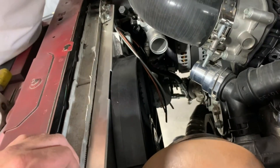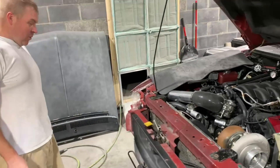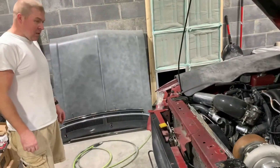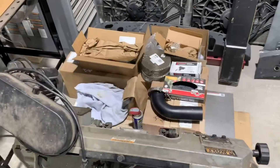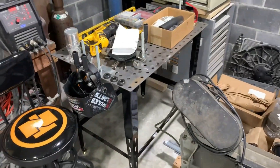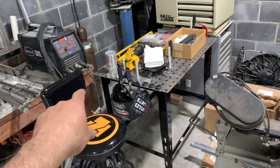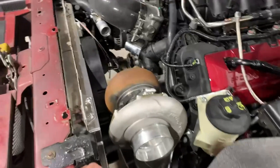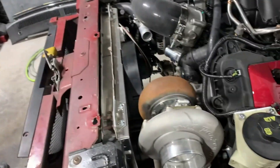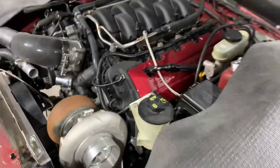Also this morning before you got here, I talked about routing the exhaust down towards that small opening underneath the ABS module. Yeah, that's about the only clearance we're gonna have — get it down in there and get the little muffler resonator on there to maybe help muffle the exhaust a little. I did take it out of the box and video that. The little TIG welder I bought when I did the stainless exhaust on my Cobra — it's been working pretty good for the first time using it on aluminum. Took a while to figure out the settings but it's been doing good.